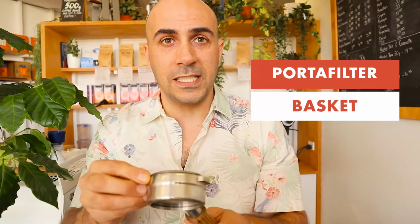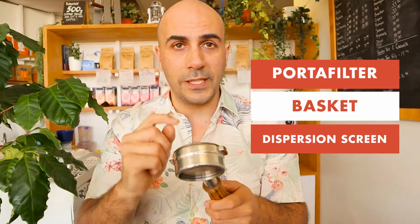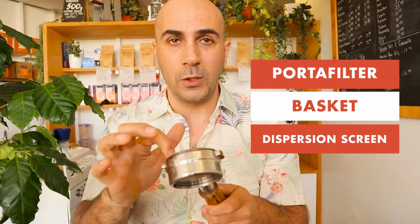So if you leave your coffee puck in there and you don't clean up underneath the group head, and you don't clean or soak your portafilters, baskets, and even the dispersion screens in chemical, you are going to end up with rancid oils in your coffee.